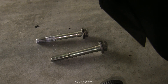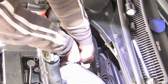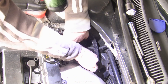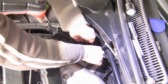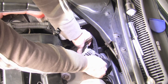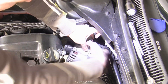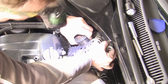I just placed the bolts so I can remember which is which. You can see one of them — the one on the far side — has quite a bit of alloy corrosion on it, which wanted cleaning off with a wire brush. We left the top bolt in until last, because of course the whole alternator will hang off it. When ready, that bolt can be taken out while you support the alternator's weight. Then you will be interested to find out that once the alternator is off the engine, it is in fact still trapped — there is not enough room to take it out. I tried every different angle, but there's no way to get it through the gap, and it won't go out the bottom either. So that's annoying.